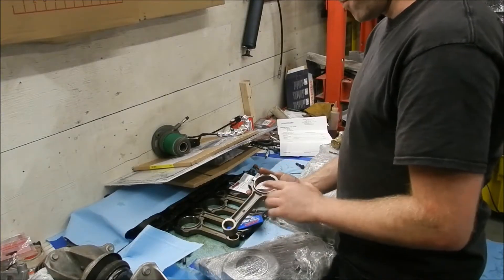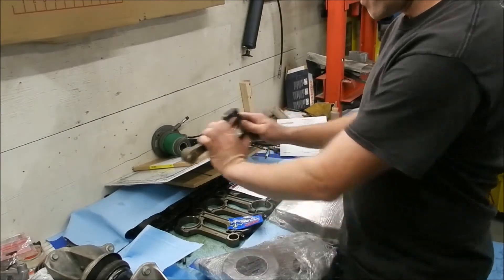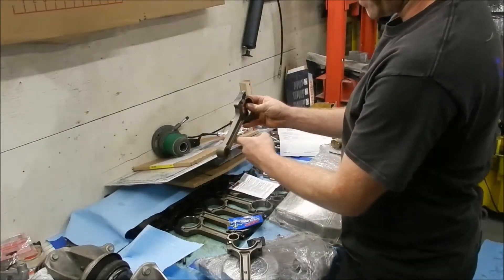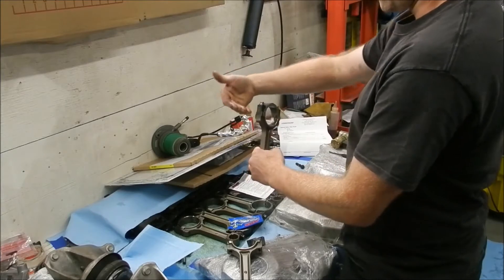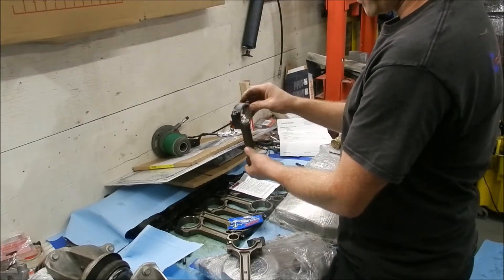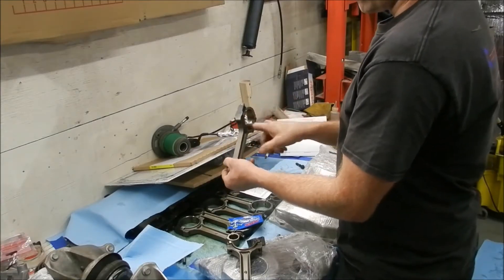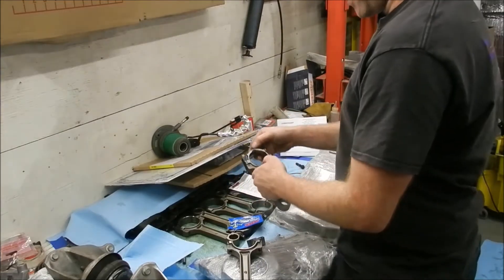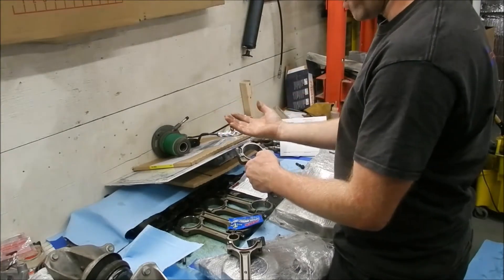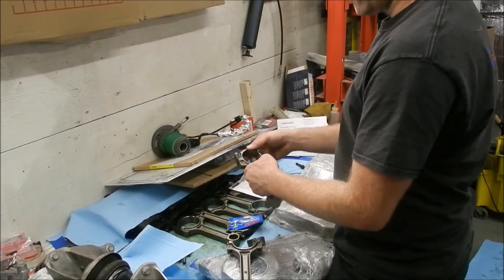There should be enough room — it should be a little bit on the tight side from the factory — and I should have enough room that they can throw it in their hone machine. It's got a peg sticking out that rotates, and the hone comes through like this, and there's a piece that it goes up against. They work it back and forth on the hone where that rod is against there. That hone will just open this up a little bit and make it round again. I think it's got two stones and then two — I don't know if you call them broaches or what — but they're geared to the stones so it makes sure it's an actual circle when it's complete.